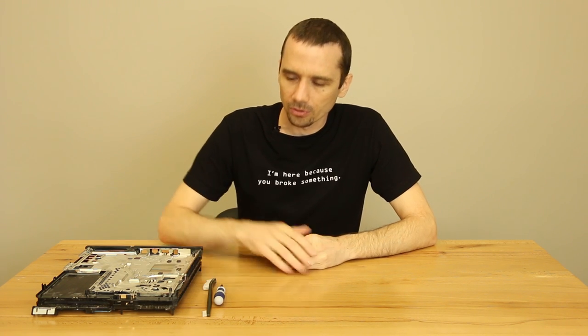As far as the causes of overheating, there are several that are fairly common. We see a lot of fan replacements — sometimes the fan won't work at all, sometimes it'll pulse on and then turn back off and pulse on again. The first thing to check is whether the fan is working correctly, and you can usually tell just by putting your ear close to where the fan is on the side of the PS4 and listening.